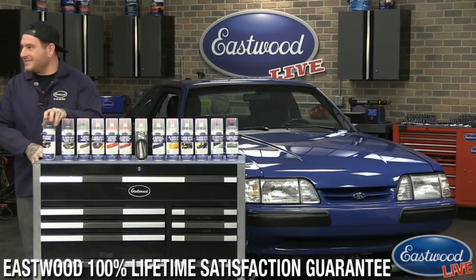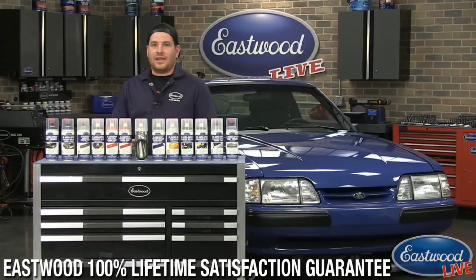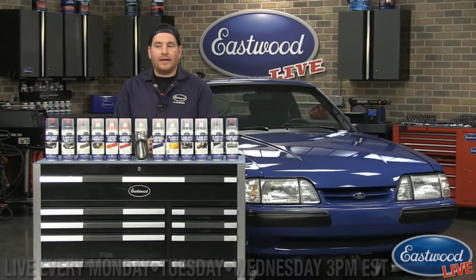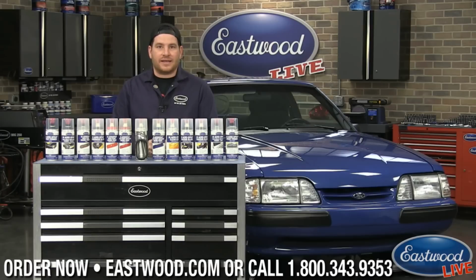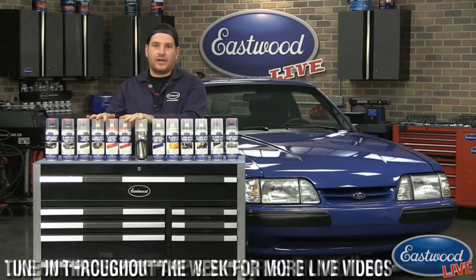Another one to touch on is fuel resistance, because somebody asked how fuel resistant they are. It's the same as far as fuel resistance goes as what you would spray out of a paint gun. So it is an activated 2K paint or coating. So it will have some fuel resistance, but it's the same as the paint on a stock factory gas tank. If you let gas sit on it for a long period of time, or if it's constantly getting exposed to it, it can break it down. But this is no different than anything you would see out of your paint gun.